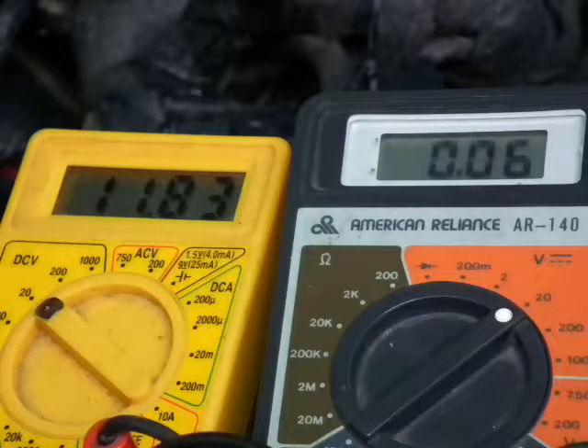Check your voltages in your power distribution box — check the voltages to the computer and all the output voltages in the distribution box. In my case there was what's called an open connection — the opposite of a short. Mine was an open connection from the output of the 30-amp fuse in the distribution box to the relay to the computer PCM, which is back here mounted on the firewall.